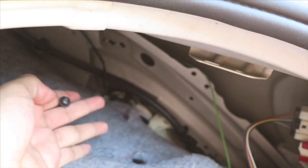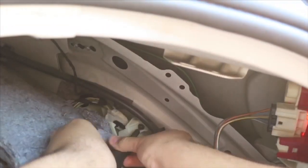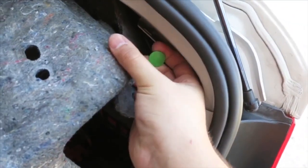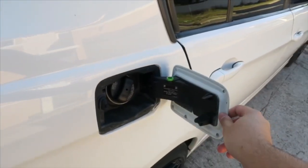You can put everything back in place. I'm going to put the screw back in because it can make noise from vibrations. Also a quick tip: if you lock the car and can't open the gas cap because of the little lock it has, if you pull the carpeting out you can see this little green tab. Pull it back and it actually unlocks the gas cap — useful if the little motor is on its way out or not working anymore.